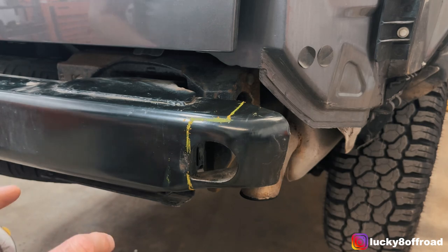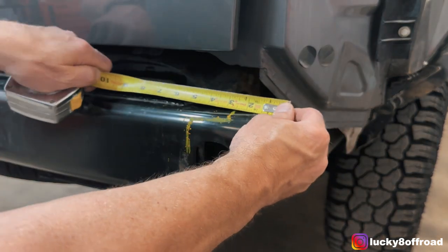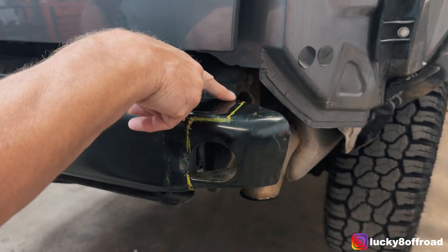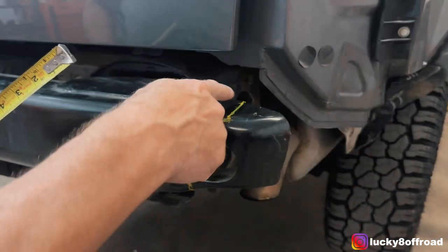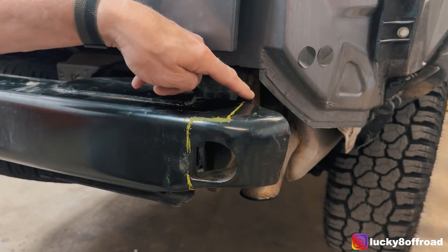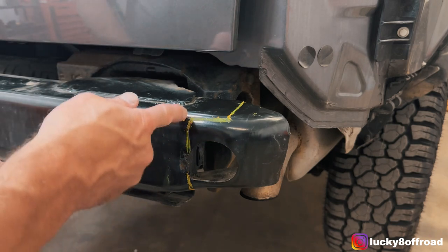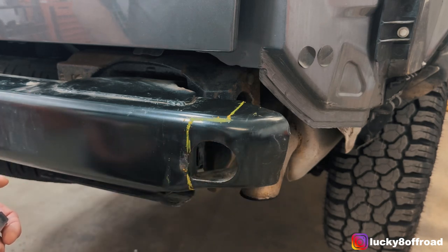Looking at the instructions online from Terra Firma, we're showing you the basic pattern of what needs to be cut out. Right from the end, I am at two and a half inches. Don't want to go too far forward to this little flat area, because that's about where the first bolt location is going to be, so we want to be a little bit to the outside of that. I'm going to cut it straight around, straight down to here. We want to leave this top portion available for other bolt locations — I'm going to come out right to where it curves, cut over, and then I'm straight in line. Avoid cutting the — it's already got a hole in it, so why not just utilize that hole. And then once we're at the bottom, straight cut off.